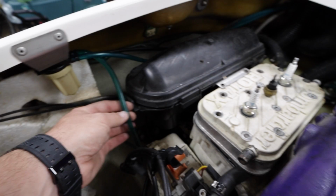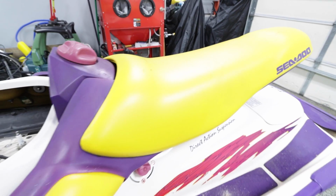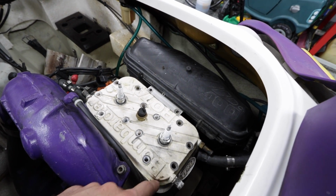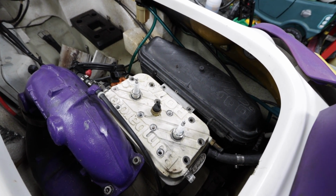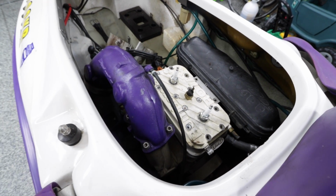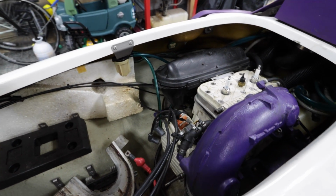Okay, so they're kind of just, I wouldn't say hard, but they're getting replaced obviously. So what we're legally allowed to do is, I pulled this head, put a stock one on it, and currently right now the squish is, I think, like 0.0685 or like 0.070. I think legally we can have 0.051 and we can't have compression over 175 pounds.